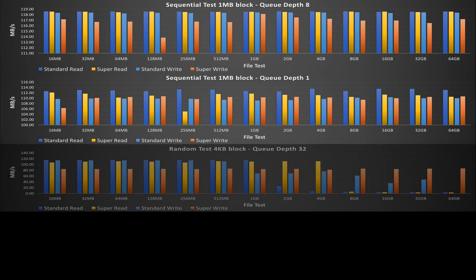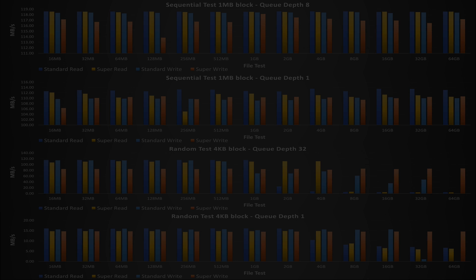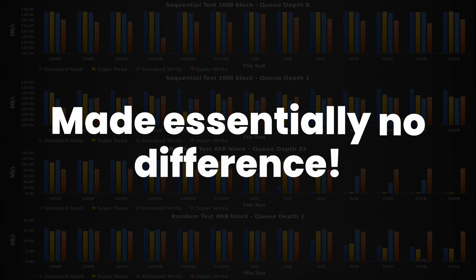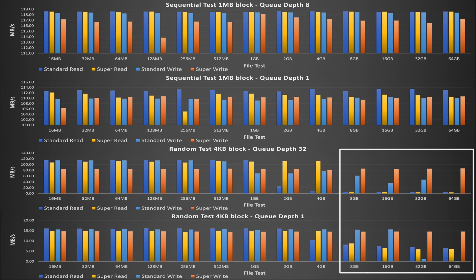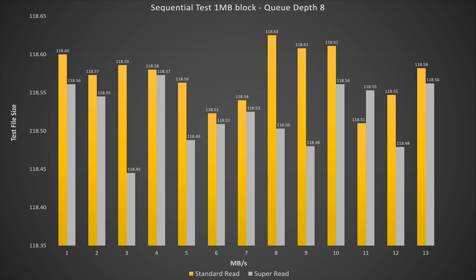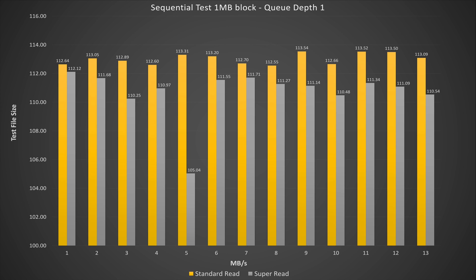Let's get to testing. We'll be using Windows File Sharing to test the performance of our souped-up DS920 Plus using CrystalDiskMark, the same way we did in our first video testing its performance out of the box. Having added read and write caches, doubled the amount of RAM, and created an LACP trunk connection, made essentially no difference to the performance of the NAS. There were small performance differences specifically during random read and write tests where the fast NVMe cache made a difference, but nothing mind-blowing. With one host accessing the NAS directly, you simply won't see better performance.